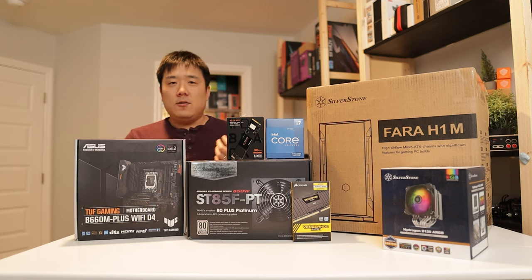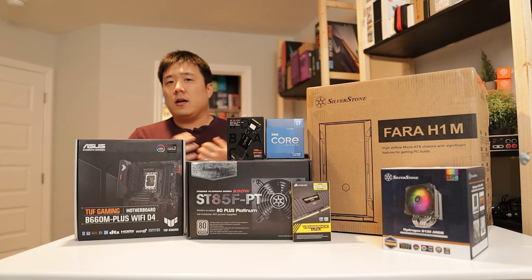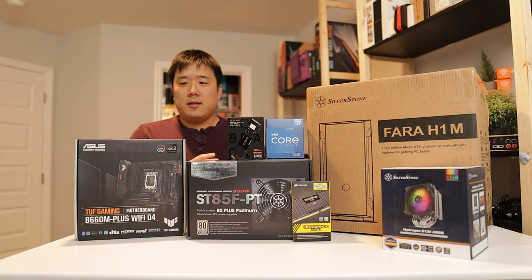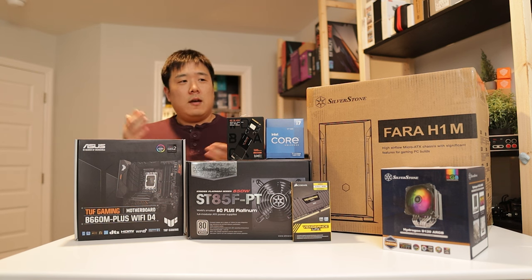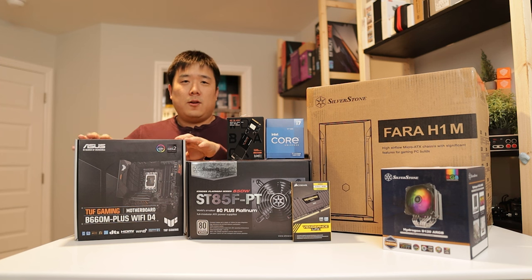If you're not using a lot of memory, then you can rely on 16 for certain. But if you think you are loading a lot of heavy models and complex projects, then you do want to rely on 32 gigabytes. And one of the benefits is that you put in 16, and if it is not enough as you go, then you can put in another 16. So basically four sticks of memory in here, no problem, which is not really possible in mini ITX cases.